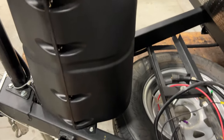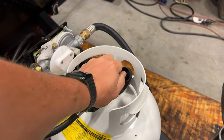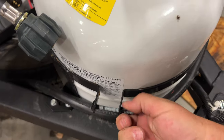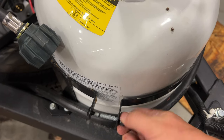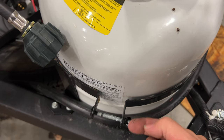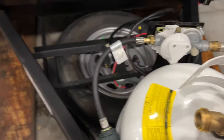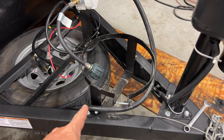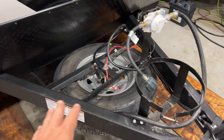Looks like the cover for the propane tank is only held on by a little wing nut. I'll make sure the valve is off, then I'll unbolt the regulator and take all the hoses and set them back there — just get them disconnected from the tongue for now. I'll probably want to reuse this bracket, but I can leave it here for now.